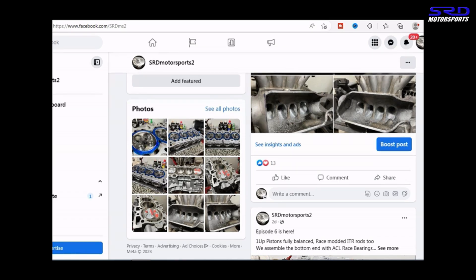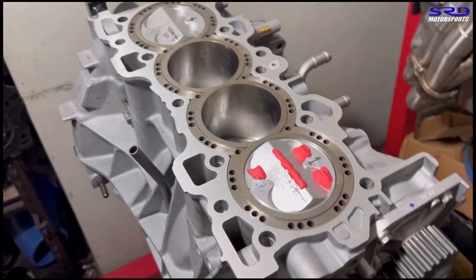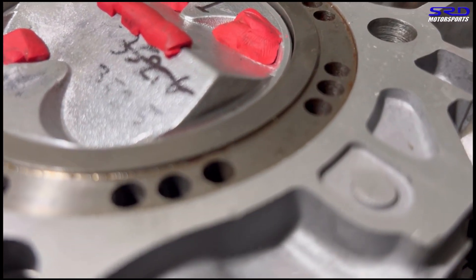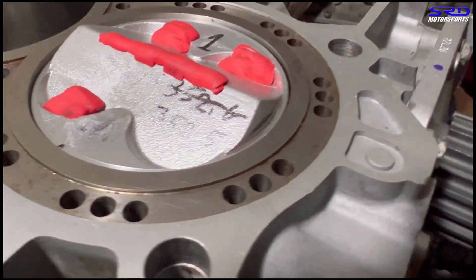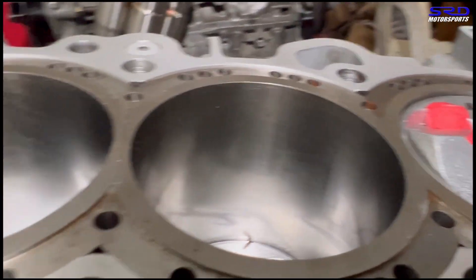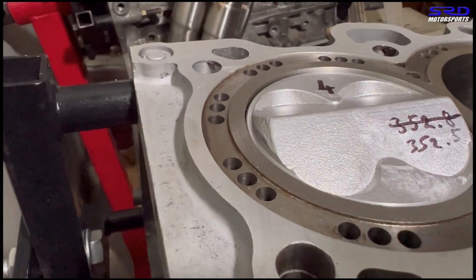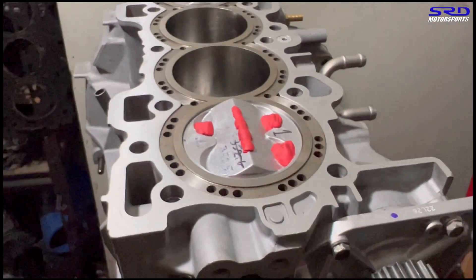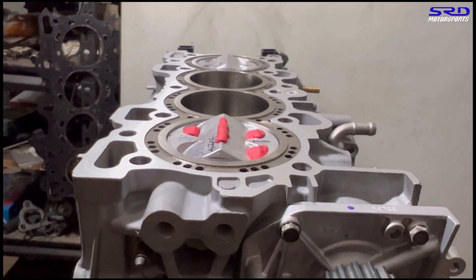We were about to clay the motor — I put on the head, torqued it up, and suddenly I couldn't turn it. I checked the cams and it rolls fine, so I pulled the head and found that the sides of the dome were actually touching the chamber. That's because the stock B16A or B16B Type R head was shaved more than 0.030 of an inch, or more than 0.75 millimeter. It had stock ports but was milled too much — the previous owner probably had to mill the head to run big cams.